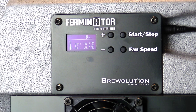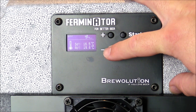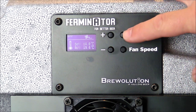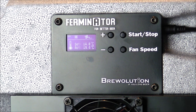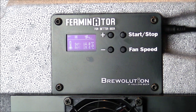To cool the unit down on the inside, press the minus button, which takes it down 0.5°C at a time. Let's set that to 14°C. Pressing the start button again, this time a snowflake icon appears on the screen to indicate that cooling is taking place, and again you can adjust the fan speed between high, medium, and low, which affects the speed at which that happens.